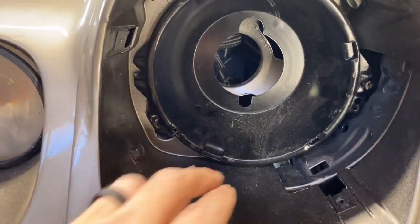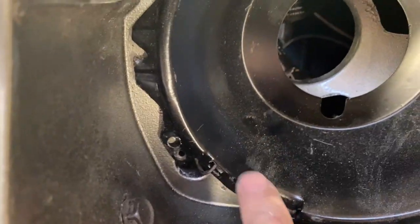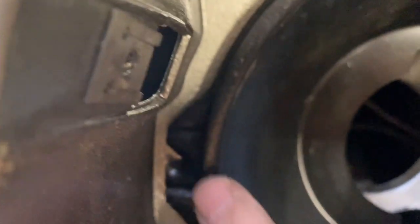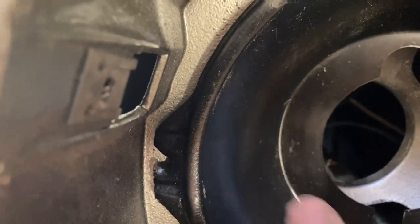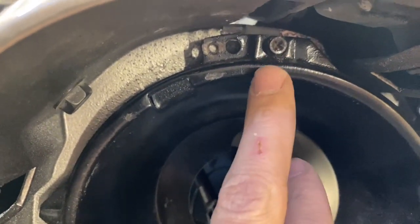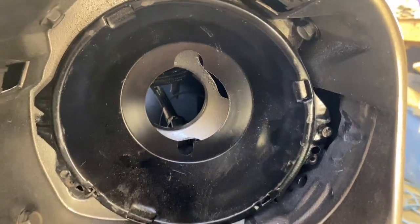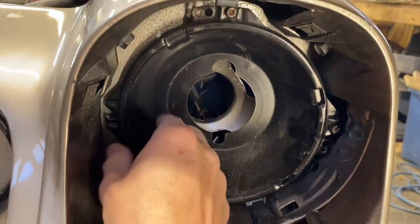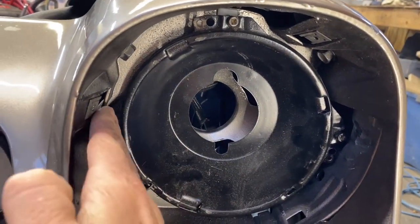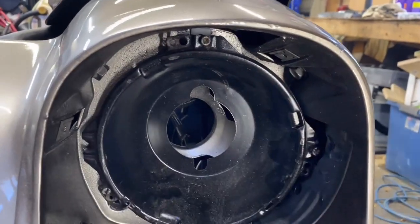Here's a closer look — right here is where the spring clipped on, and there's the adjuster with a groove in it. It just slides into that little slot on the adjuster screw. As you can see, this part is now solid and not moving — the spring is holding this side back, and the whole cup pivots in there so there's tension all the way around.